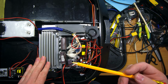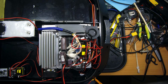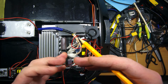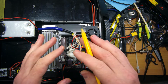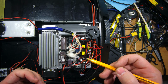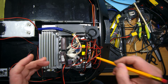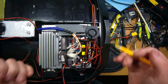It is necessary to note that you have to pay a lot of attention to the waterproofing of the front light of the wheel, because its daytime running light was assembled really badly. You have to disassemble it once more. You have to pour a special lacquer on the LED boards. After assembling it, you have to cover all the holes with the sealant to make sure that no water will go inside and damage this daytime running light and make a short circuit and possibly damage something on the DC-DC converter, which is really an unnecessary thing for every EUC owner.